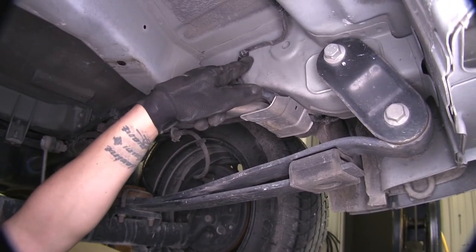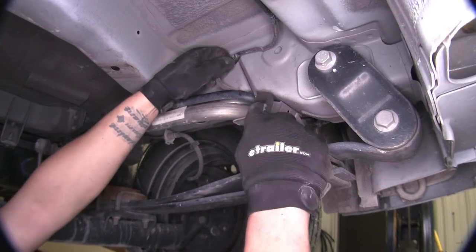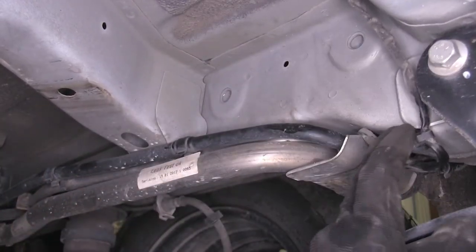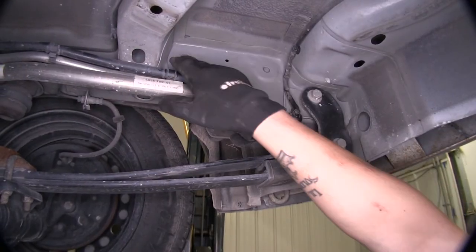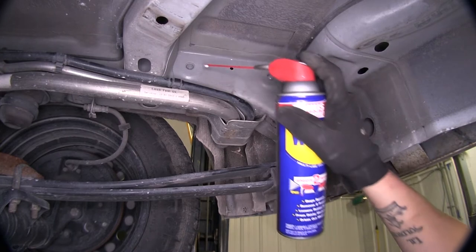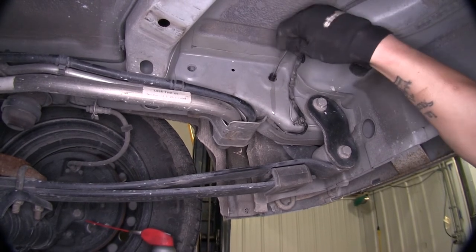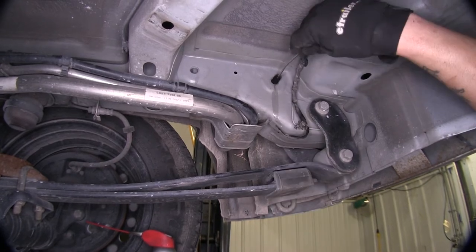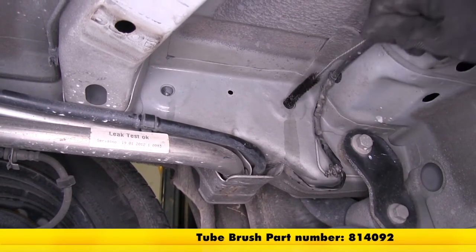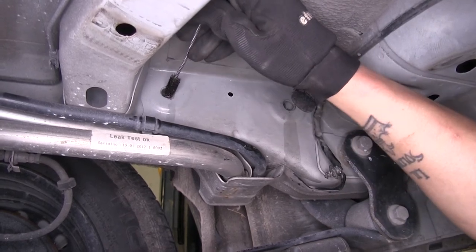Now on the passenger side, you're going to see a wire attached at two points on the frame. I'm going to take a small screwdriver and pry out the clip that's holding it against the frame, and we're just going to move this to the side for right now. Pay attention here — these are going to be our existing weld nuts that we're going to be using. I'm going to take a little bit of penetrating oil, spray it in there, and take a nylon brush to clean out our threads, making sure nothing's going to contaminate or mess up the bolts. You can pick up one of these brushes on our website using part number 814092. I'm going to clean out all of our weld nuts — we're going to have two on each side.